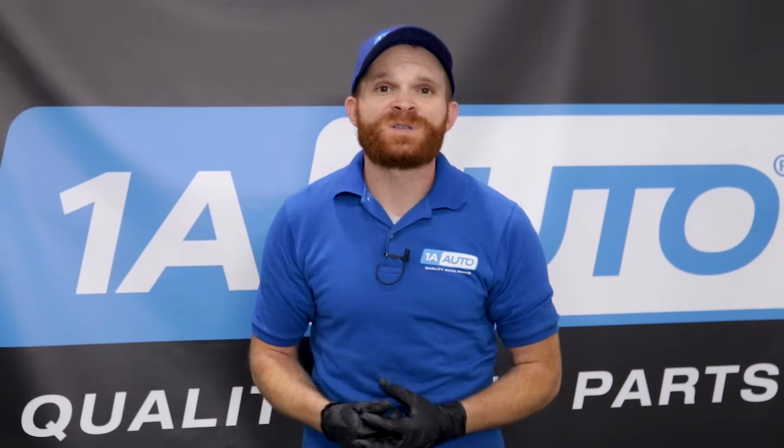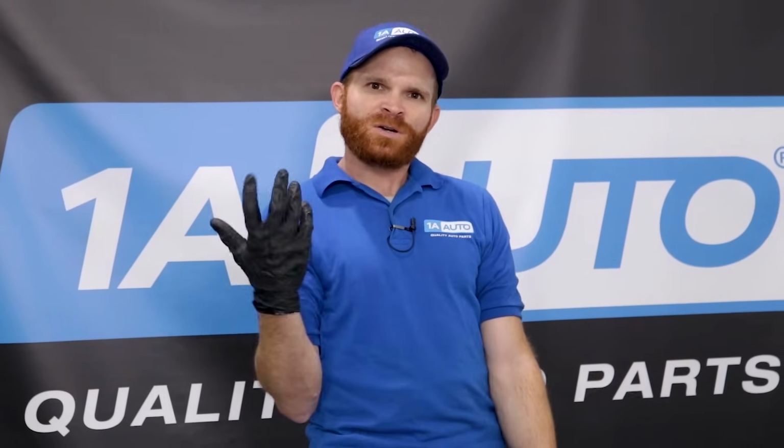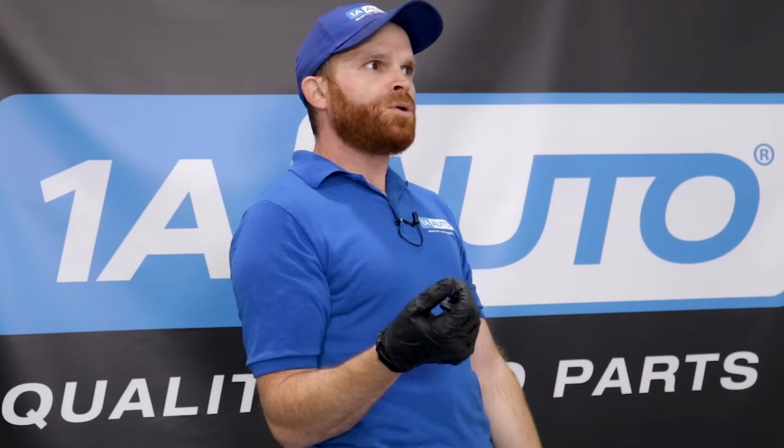Another quick symptom that you might happen to notice, and it kind of goes along with one of the other ones that I had mentioned, would be throttle response. Maybe you're sitting at a red light and the vehicle's just idling, and it's idling just fine. The light turns green, you go to take off, and the vehicle goes boop, boop, boop, and then starts wanting to take off. But it's very laggy throttle response, where you really want it to go when you say go. Essentially, why this might happen would be possibly because of the pump having low fuel pressure, or even maybe there's a clog in the system, such as your fuel filter, which would be a very common cause for this, and a pretty cheap fix overall.